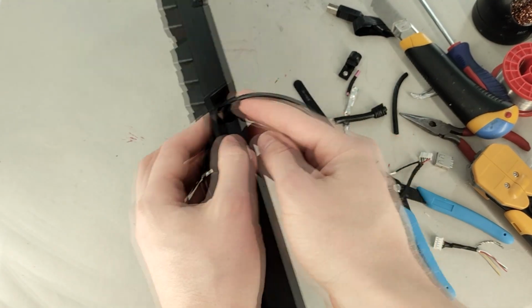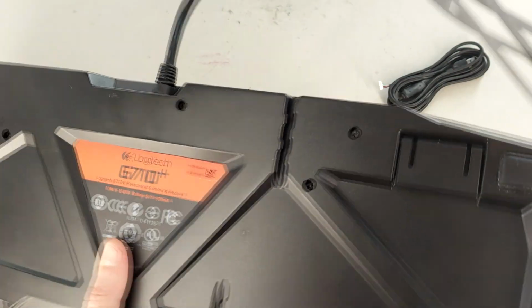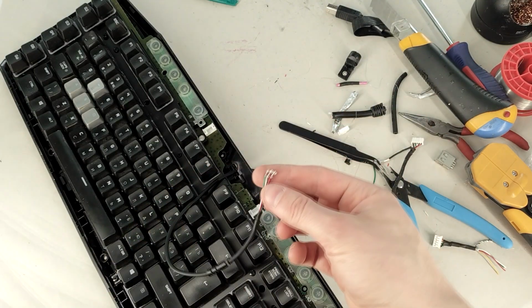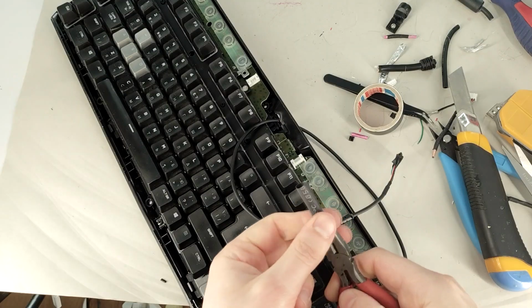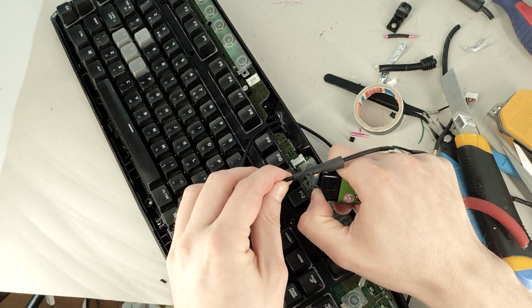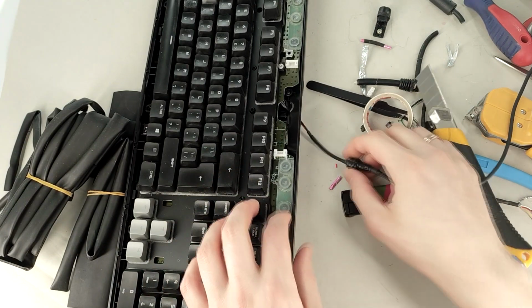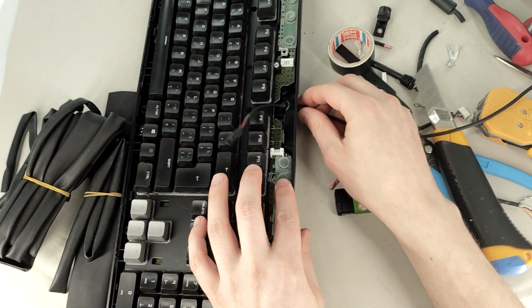This is the hardest part in this repair process because the original cable was much bigger in diameter. Remove all wires from the connector to make it easier to slide on some heat-shrinking tubing. Cut and stretch a few pieces of larger tubing. Attach them to the cable. Repeat this step until you build a bump out of heat shrinking that's big enough to fit snugly into the hole in the keyboard housing.